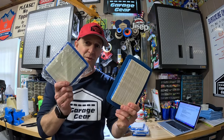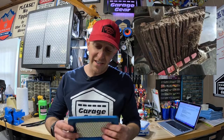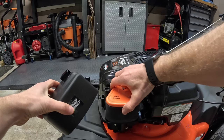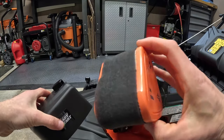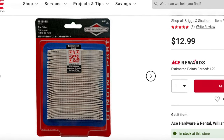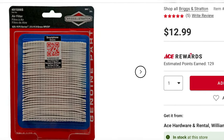Number two: air filters. Just like you, your engine needs to breathe clean air, and it's important for proper combustion processes inside your engine. You should check these out at least once a season and swap them out if necessary. Typically, I like to buy these in bulk. If you go to buy a single air filter at the big box store, they tend to mark them up quite a bit — I can usually get two or three of them for the cost of one. I'll have some common lawnmower air filters linked down below in the description.